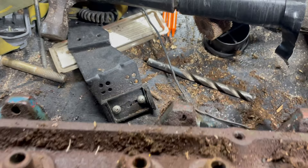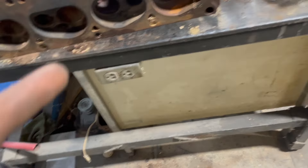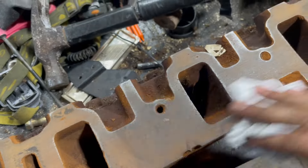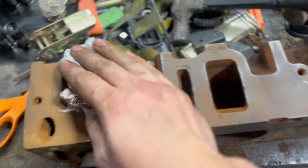I was really worried that since it had no valve cover and had been sitting out for so long it would be completely seized up, but all the valves came right out — none of them were even stuck. I put the valve spring compressor on it and the spring compressed right away. We shot PB Blaster on it last night but that probably wasn't even necessary. Now I have some 80-grit on this block. It's a usable head — obviously needs a lot of work, but it's really not that bad.